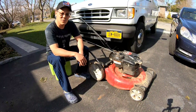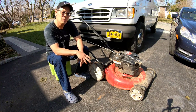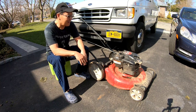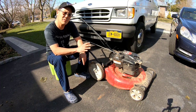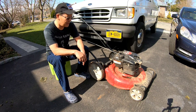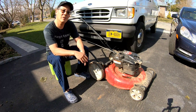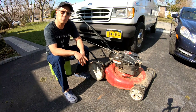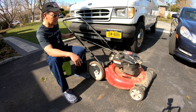So I'm really satisfied with what we did today. To get this thing that was in somebody's garbage, put a blade on there, made the blade fit, works just fine. Put a spark plug in there, figured out that it was the sheared key in the flywheel, and the flywheel was cracked along the input shaft there. And we replaced it with another type of Quantum flywheel. And as you can see, works just fine. Starts in one pull with this auto choke Briggs Quantum engine, and tighten up the attachments here for the handle.